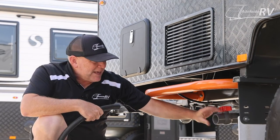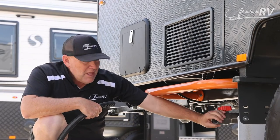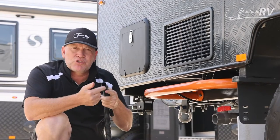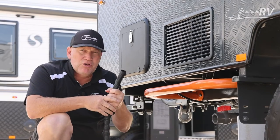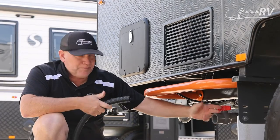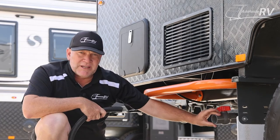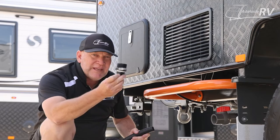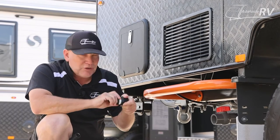The main thing we are talking about today is the piece that comes off your van. A lot of caravans nowadays with a grey water tank don't have a one inch or 25 millimeter fitting that you can just plug the hose into — they now have this larger one and a half inch, 40 mil, or 38 mil piece. So you need a reducer that you will buy from somewhere like Bunnings.